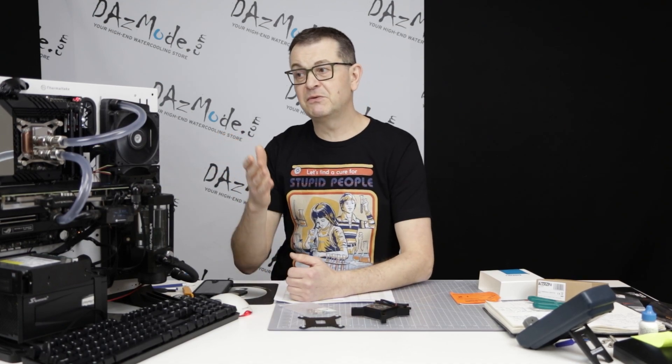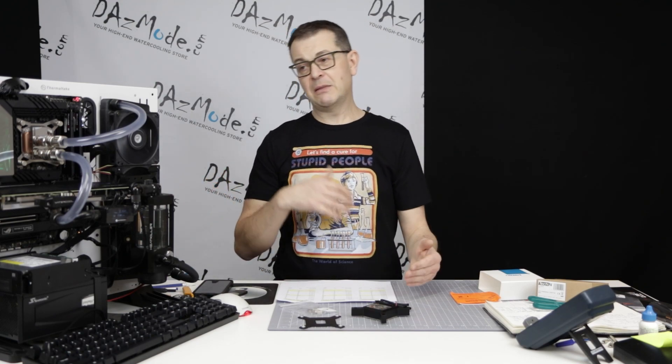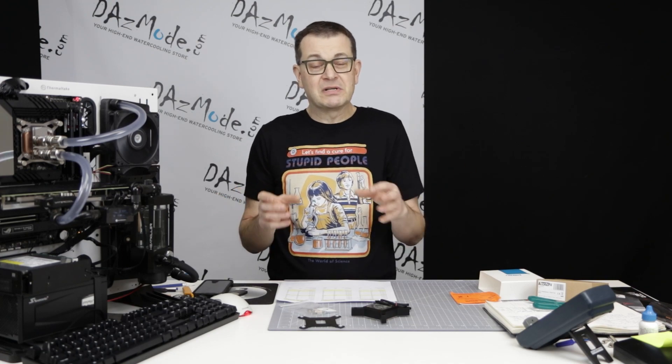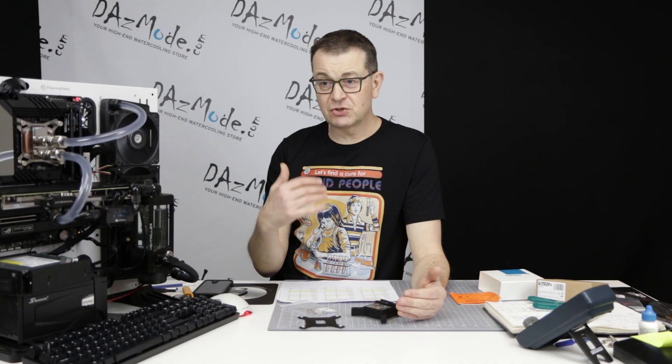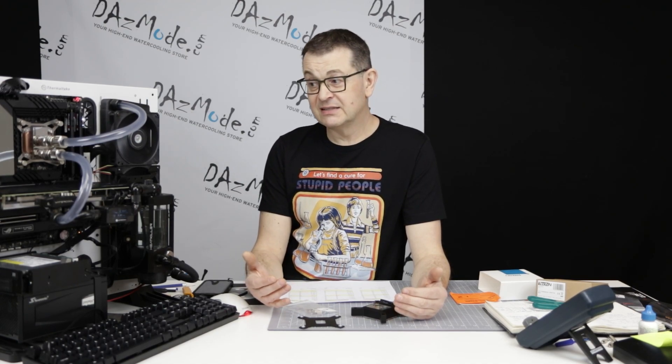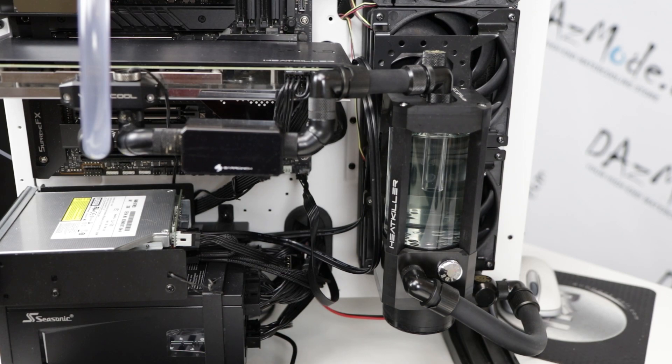That was the experience across my 7 mounts for the Heatkiller — the difference between the worst result and the best result was 10 degrees. And it's not like totally crooked, just marginally, slightly misaligned. Basically, I don't know if it's a defect of the architecture or what's going on, but this platform is so sensitive to mounting that to get the most from your cooling, you might want to do like 10 mounts and make sure you get a good result. 10 degrees is the difference between having a triple radiator or two triple radiators — roughly $100 worth of hardware.